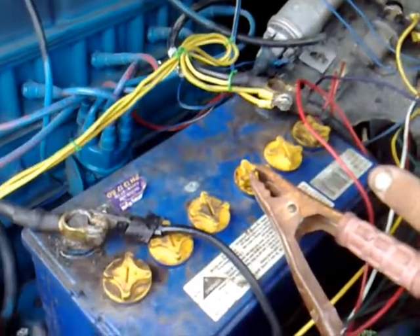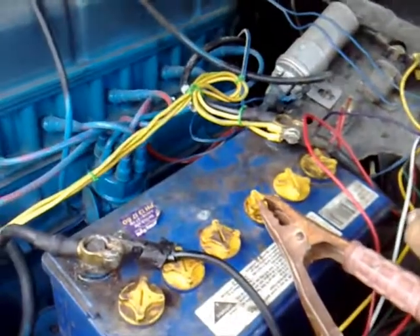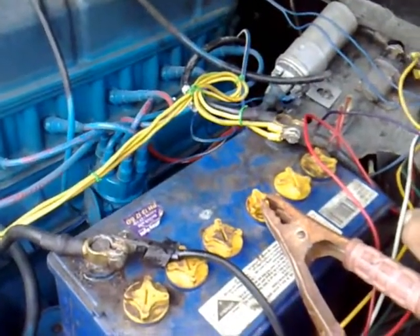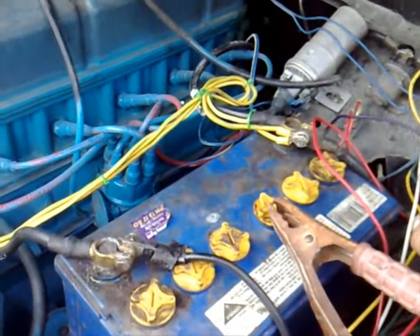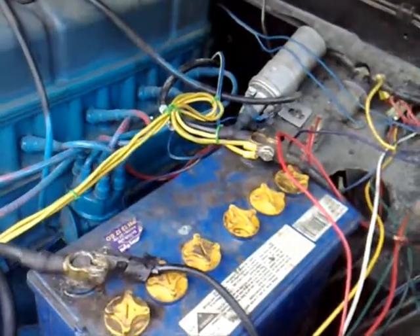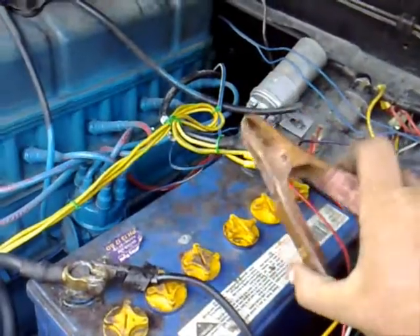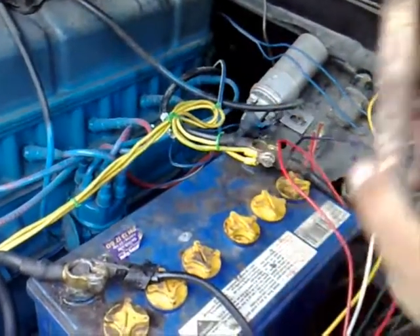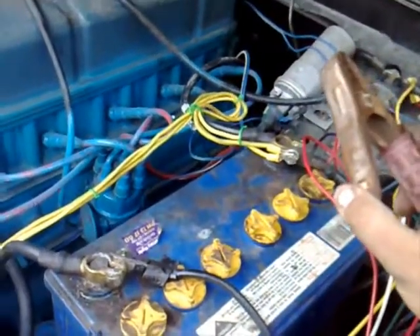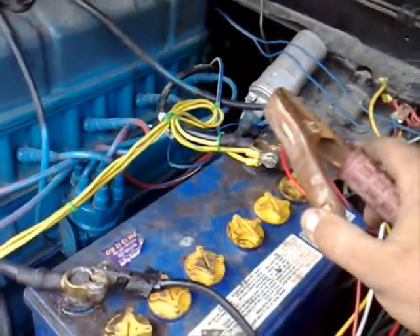You'll know if you have a dead flat battery — like if you've left your lights on overnight and come out in the morning with no power at all. Then when you hook it up to the other vehicle you may actually want to leave it hooked up for 5 minutes before you try and start the car.